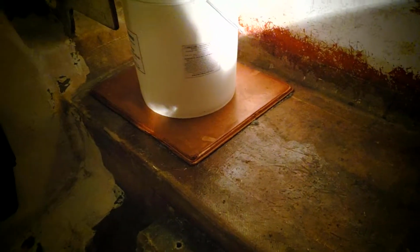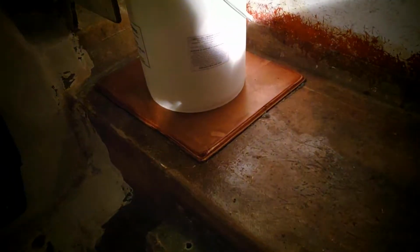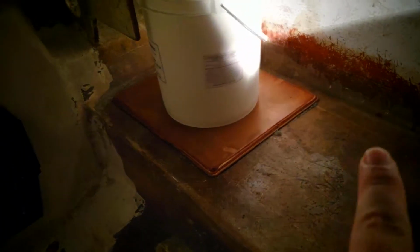Okay, so if you notice back here, I got my sacrificial pieces cut out for the batteries, the trim pump, and my bilge pump down there. So I just peanut buttered them in. I got some weight on this one. This one I think is okay. I still need to get back here real quick and fill it out before it sets up.